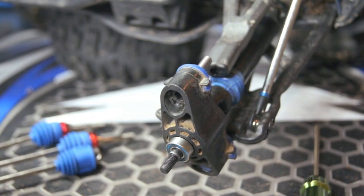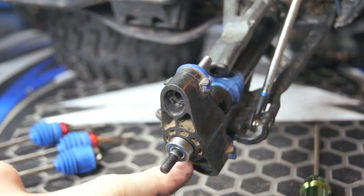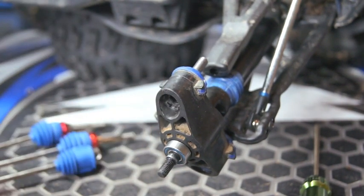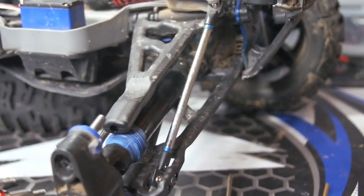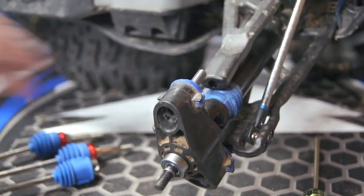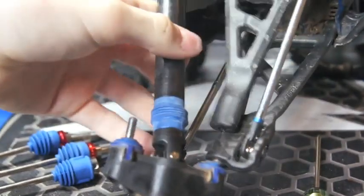What I found out is you do not have to take out the lower screw. All you have to take out is the top one, the one that holds into the 17-millimeter adapter, and the grub screw that holds the old drive shaft into the bulkhead. Once you have those undone, it just pops right out.